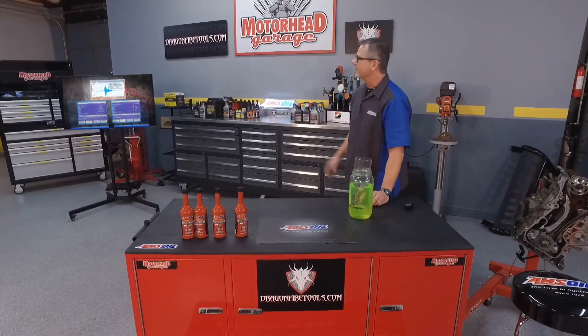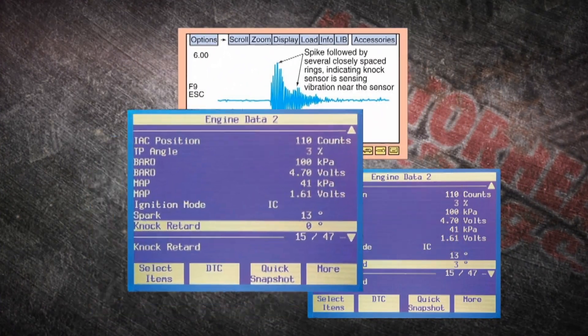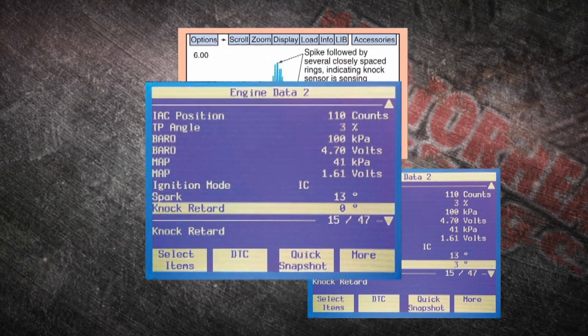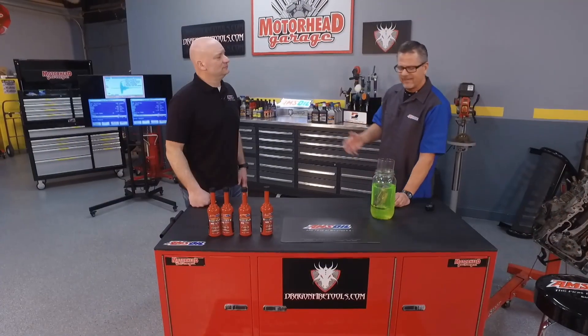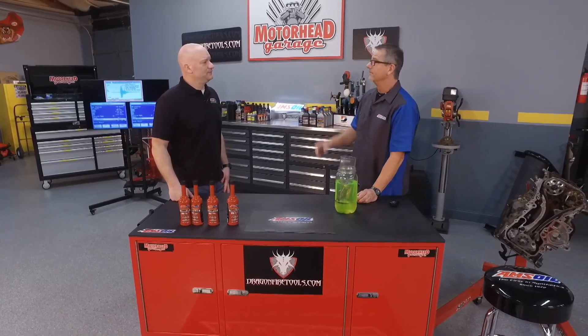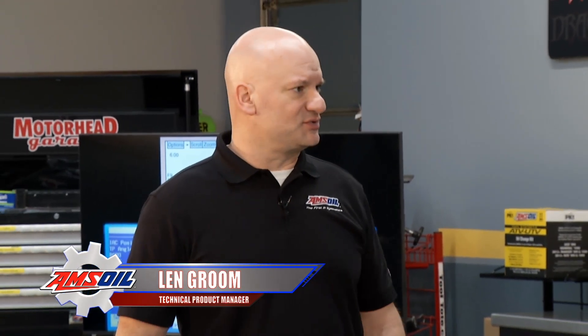You can look at the graphic right there — you can see the computer on top actually sensing that vibration, and down below you see the knock retard at zero. Nothing's going on. When it starts rattling, it's at three degrees retard — and at three degrees retard, you're losing power. People may not even notice that until they go to fill up at the gas station and realize they're using more fuel and the car isn't as responsive.